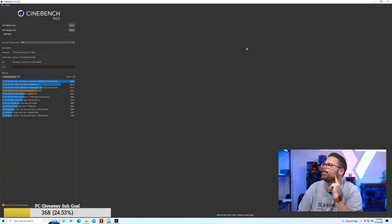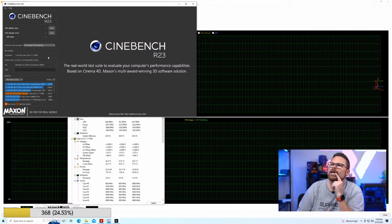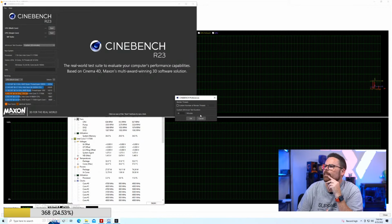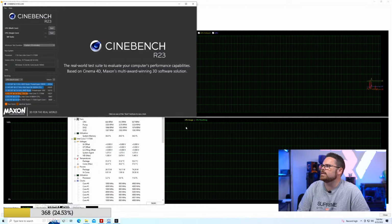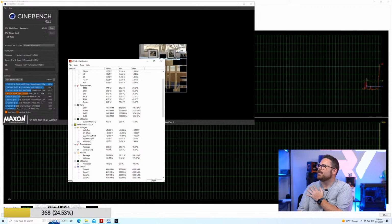Okay, we're gonna go to File, Advanced Benchmark. We're gonna do a 30-minute test, which means, well, actually we'll do a 10-minute. We're gonna set it to 10 minutes instead of 30. There we go. So you guys can see it here. And then we'll do custom 10 minutes. And we'll run multi-core. And then now we're gonna watch temps here. Okay, so here we go, 69, 70. You guys can see them here too for our CPU stuff.